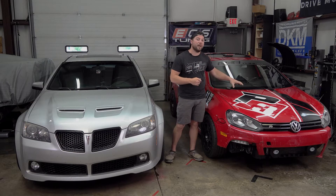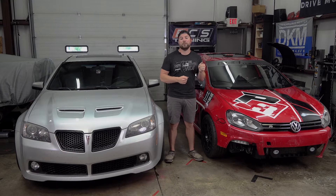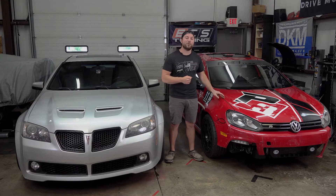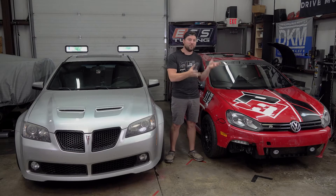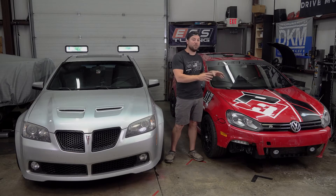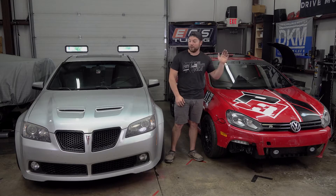We're going to start on our Golf R with an ethanol blend tune. Our friends at Unitronic supplied us with a stage two tune for this, also a nice big intercooler. Both have been working great, but John over at Unitronic has let us know that with our setup we can safely run up to E20. We don't have specific tunes based on ethanol or 93 octane, but we can safely run up to E20. So we'd like to add an ethanol sensor so we can see it on our gauge and know where we're at on ethanol content.